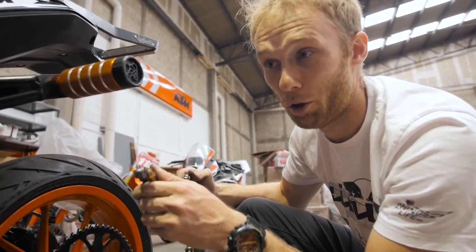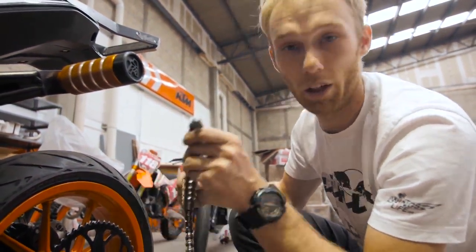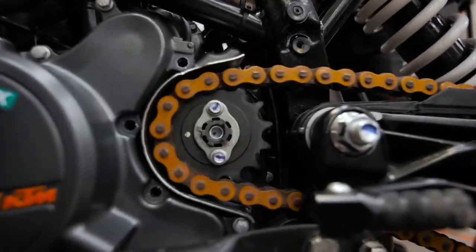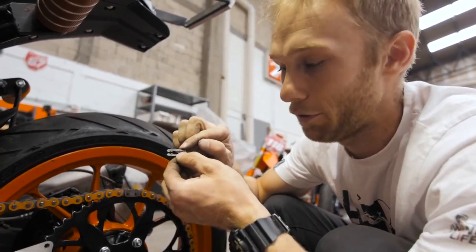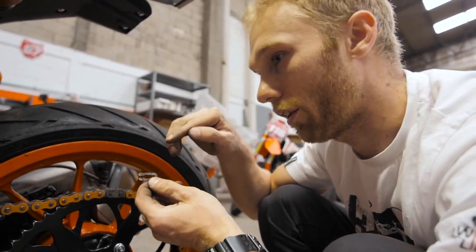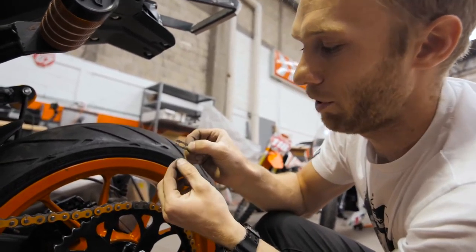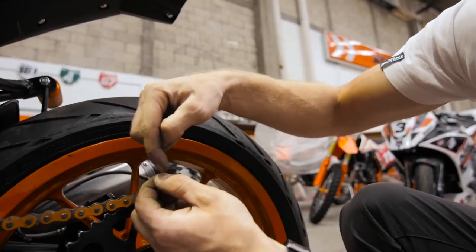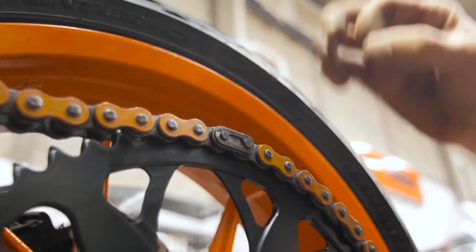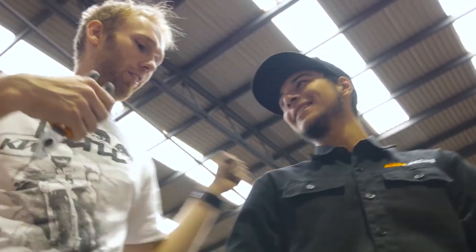So I'm gonna show you how to properly mount a chain — that's the rock-on tech tip. There are millions of ways to do it; I do it like this. I remove the chain guard for easier access. The last thing is to put the pin — the safety pin. What's important: the chain is going this way, and if the pin is facing this way, it can hit an obstacle. When it's turning, the chain can fall down and you can crash. The simple fix — turn it the opposite direction. If it's still hitting something, it will not fall down. Put it like this. Thanks Alex, gracias chico.